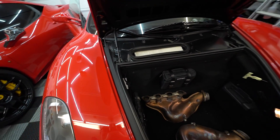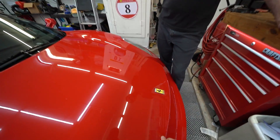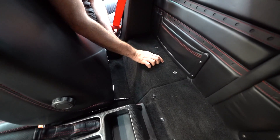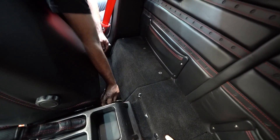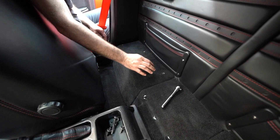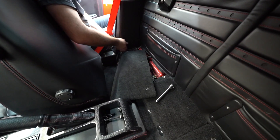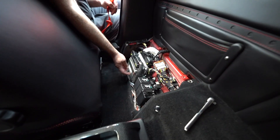The trunk switch is missing on this car but it's just a T40 Torx bit. We'll take the trunk and not shut it all the way. Also, if you have electric seats, make sure your seats are forward before you disconnect the battery because you've got some screws here you need to access. We're going to take this panel off on either side — a 4mm Allen is the tool you need here on the F430. You have five Allen screws, one of them is really long.